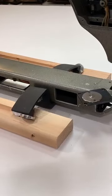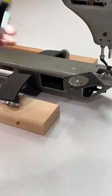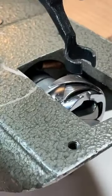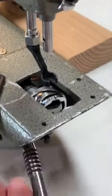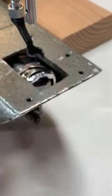Cindy says, does the wick lay on top there at the bobbin? Yes, it lays across the top. Usually there's just a little loop in it, and we're talking about down here, back in here. Sometimes it's hard to see, but you can almost always see this little copper shaft that comes out of there. The wick just lays across that cam and wicks a little bit of oil on there. Sometimes if you're blowing this out with canned air, that little wick will get blown up, so when you're cleaning, just have a peek back in there and make sure that it's laying back down.